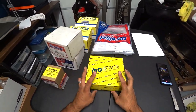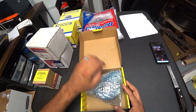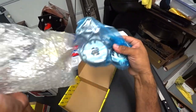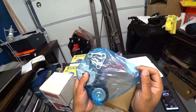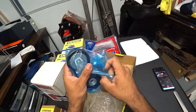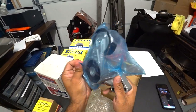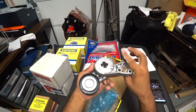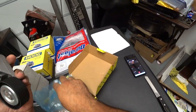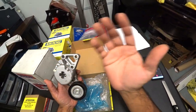First set, number one here. This is kind of a minuscule or tiny DIY, but this is an important DIY because a lot of people keep neglecting this part. This is your accessory belt tensioner. No one ever replaces it until it's too far along. We got a brand new tensioner with pulley. These guys are easy to install — legitimately three bolts and pull the belt off.